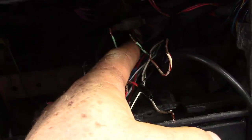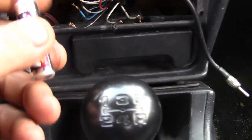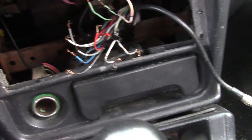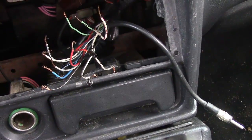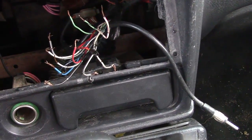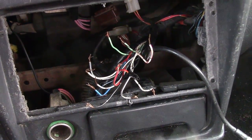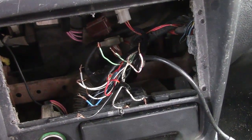That's all you have to do — put power to it. So let's say if these speakers were hooked up, I put power to that and boom, that speaker started making noise. Then I know it's my front right speaker, and vice versa for all the other doors and speakers. You're not going to hurt it if you do the wrong ones — it doesn't hurt anything. But this will determine which speakers are where, so you don't have to guess and possibly hook up your deck wrong and blow something up.